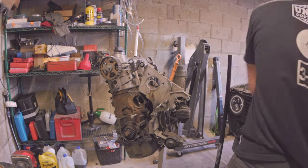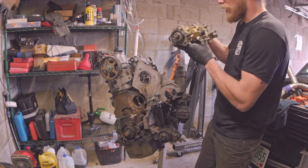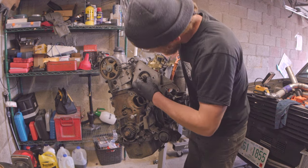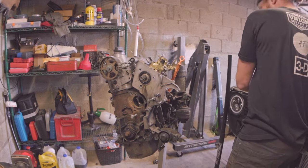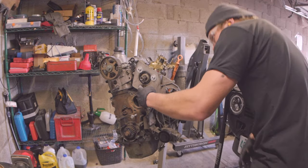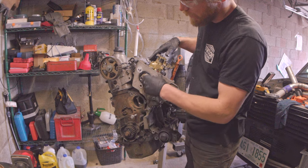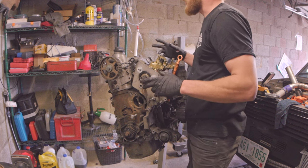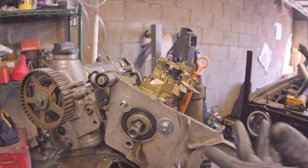The other thing I probably should have thought about is that I'm not actually going to use the cold start lever, so I probably should have just taken it off. But for the sake of this being 1.6 compatible, oh well. That looks like we're going to get our full range of timing motion now. I'll bolt it up. This bottom bolt is going to be a huge pain to put in there — I should figure out a way to glue the bolt to the pump, or use the original pump fastener, that weird one that snakes in. That'll work fine.